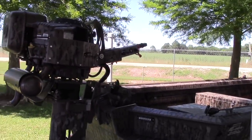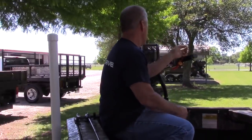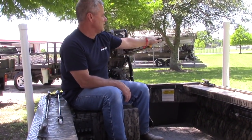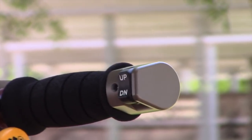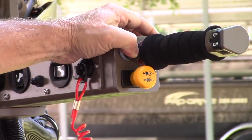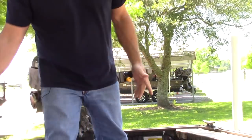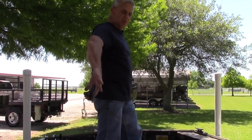I particularly like to run it lower because most of the time I'm going to be seated in the boat. You put your safety kill switch on. We put a trim switch on your tiller handle — that way you can do it on the fly without looking back. We also have a momentary bump button. What this does is it bypasses your engagement switch and you can just bump it. When you have your finger on it, it's in gear; the minute you let your finger off, it's out of gear. This is really nice when you're picking up decoys — a decoy comes by, you just let your finger off the button, it goes to neutral and you pick up your decoy. Or if you're in a tight area in the woods and you turn it one way and bump the button, your boat seems to turn a lot easier.